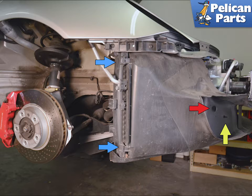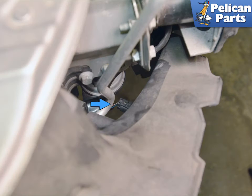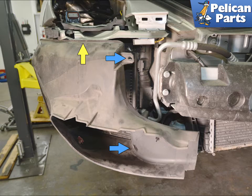You are going to remove the air diverters. There is a temperature sensor on the right side diverter but not on the left. Release the two plastic clips. Here you can see one of the access ports for the 13mm retaining nuts. Disconnect the electrical connections for the temperature sensor from behind the diverter. Remove the two front-facing 13mm nuts, the one on the top, and pull the diverter from the radiator.